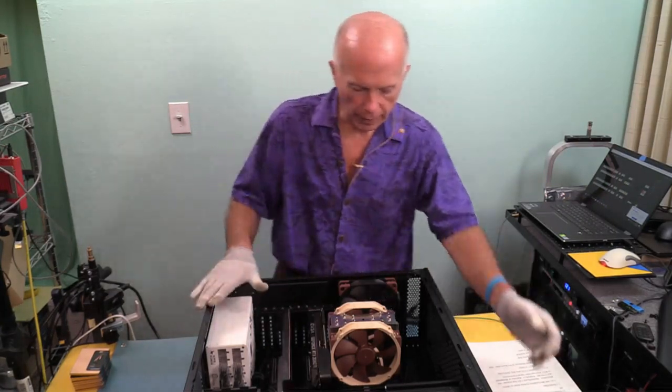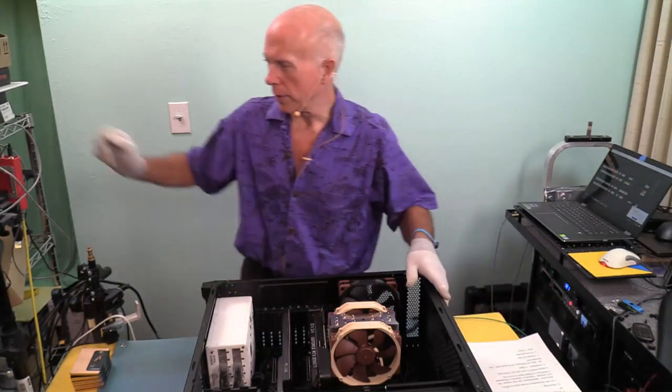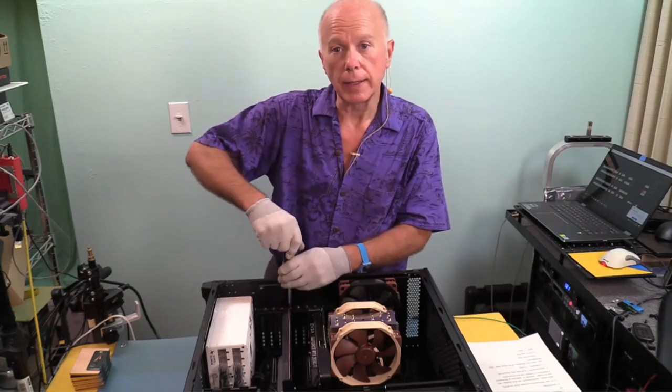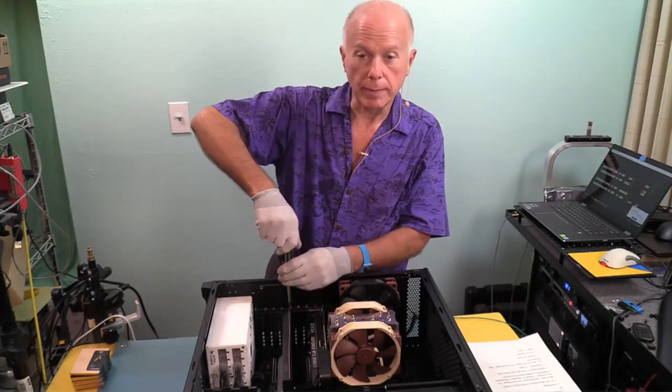Okay, we've drained the power. Power supply is off. Check that button one more time. We're going to pull the card out so we can get into the BIOS and see if we can manually configure that and tell that slot to bifurcate.